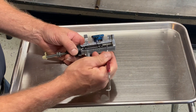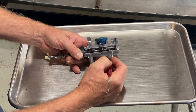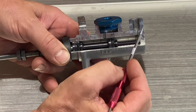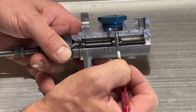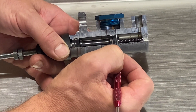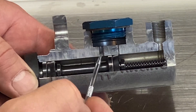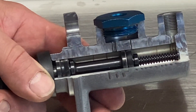Let's take a closer look and see exactly what's going on. This is an automotive racing master cylinder, but in how it works, it's just like a motorcycle master cylinder. This right side over here is the pressure part — the working part sending pressure down to the caliper. This is your outlet port. This port over here is just the inlet port, and this is your pressure seal. You'll notice there are two ports coming down — very tiny ones. This one's only about twenty-five thousandths of an inch and goes to the reservoir area. Then this one's about an eighth of an inch — this is the one that does the main filling whenever you're bleeding your brakes or filling it up.